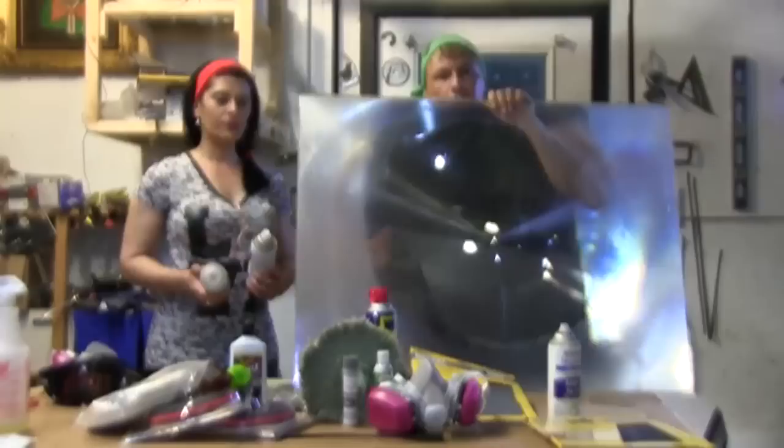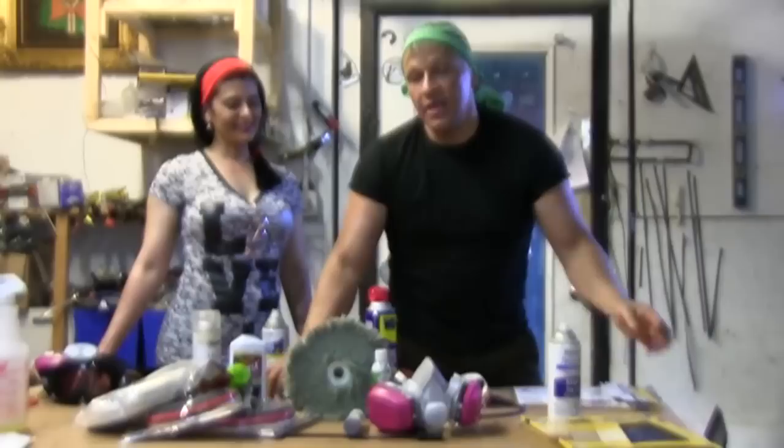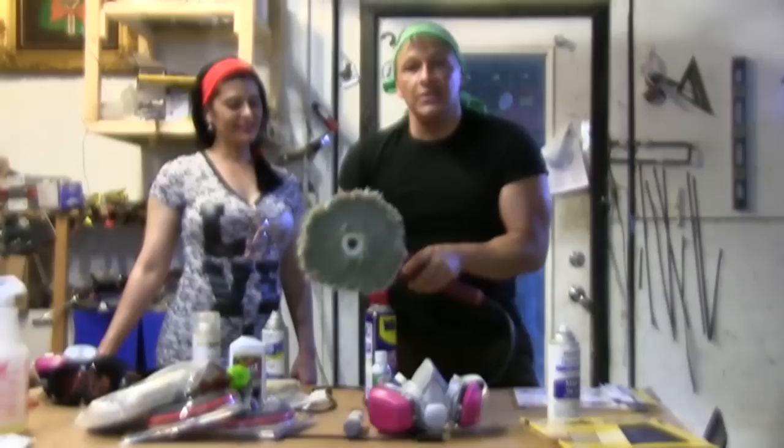The second way to do it is to spray a clear gloss spray all over the lens — you want to do this on the front side. This requires a little bit of skill because if you do it wrong or if the humidity is not correct, you end up with a fogged up lens and it's really difficult to take care of that. What we're going to be doing in this video today is show you how to sand those lines out of the front side, then progressively remove the sand marks and finish off with a nice buffing. This can give you a crystal clear lens assuming that the lens is the right candidate for this.